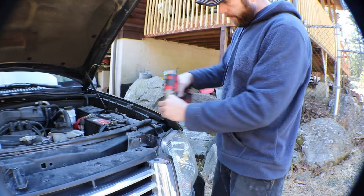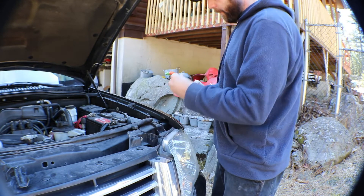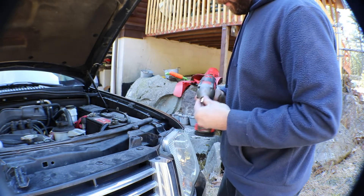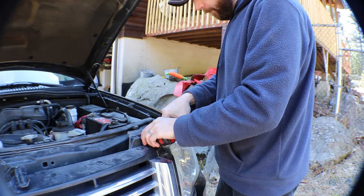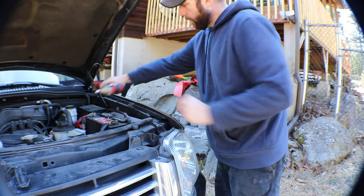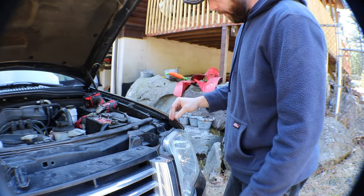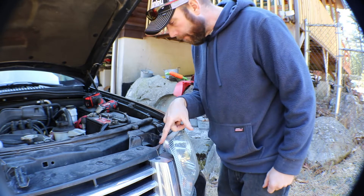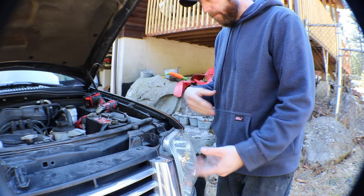All right, you take out these two 10 millimeter bolts on these Ford Explorers. One on the side, one on the front. I'm going to need to get an extension — actually, I got in there. Next one I have to get an extension on. These had LEDs in them before and they're kind of giving me some problems. Actually, there's one more down there — there are three of them: these two top ones and a bottom one. I'm going to get an extension and get this one out.